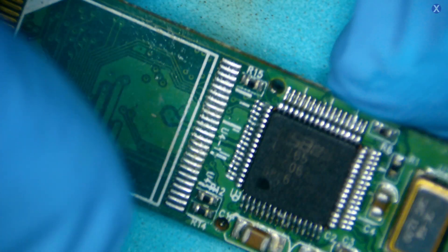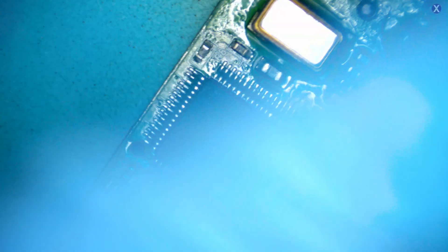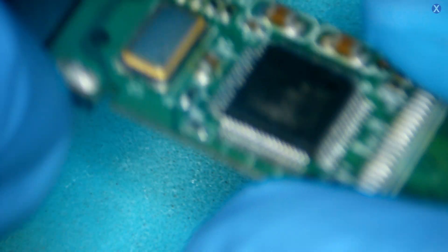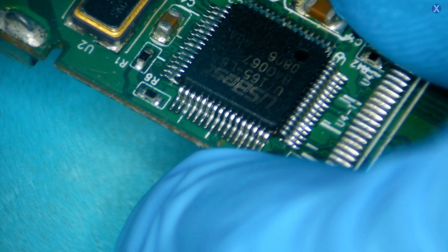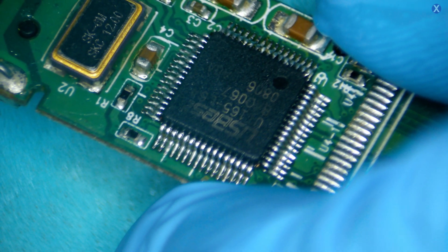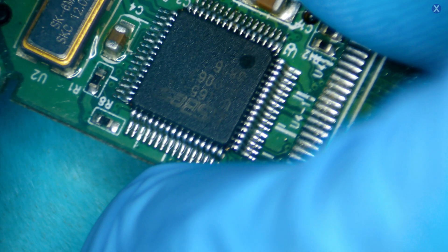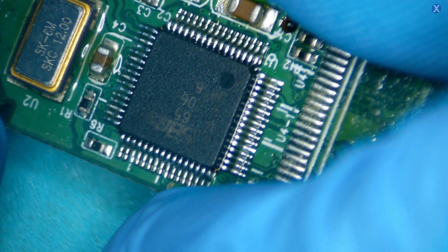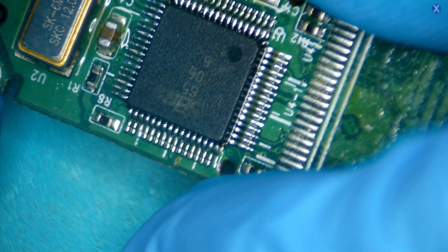When we go further back we can see there is a controller. This obviously won't say Micro Center on it — but if you look closely you can see it. It's called US Best, and it has a controller number. This is what communicates with the rest of the drive. If you see damage to this controller, this is what helps read the rest of it. Sometimes you can replace it, but in this video what we're going to be doing is a recovery that doesn't use that controller, because the controller is most likely bad — that's usually the case.